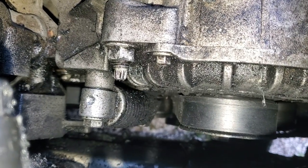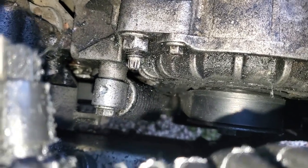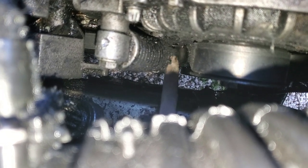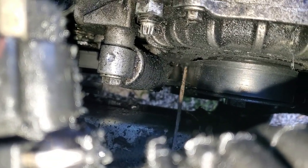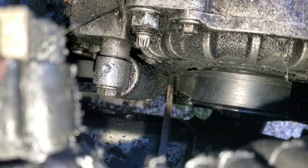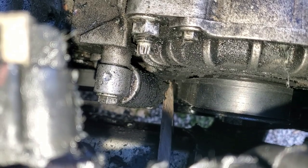The cause of this pulley misalignment is a bad tensioner — right here — with the spring at the bottom. There's a pulley attached to the tensioner, making this the tensioner pulley. The bearings are completely broken, allowing the pulley to move in and out, causing misalignment and causing the belt to not remain stationary while spinning.